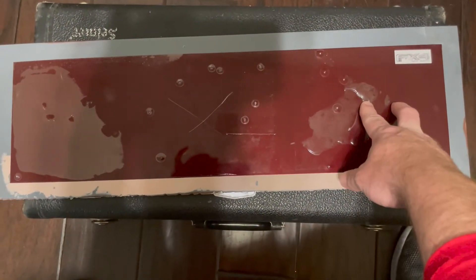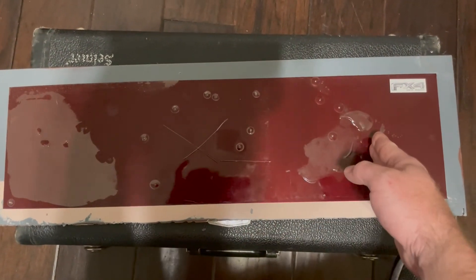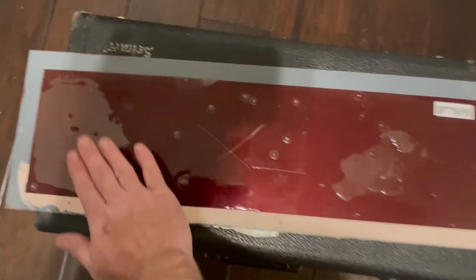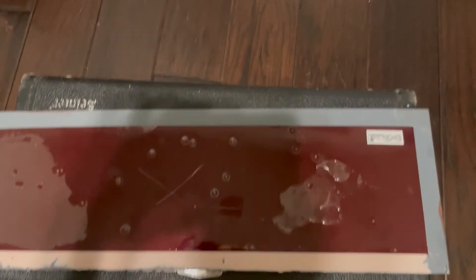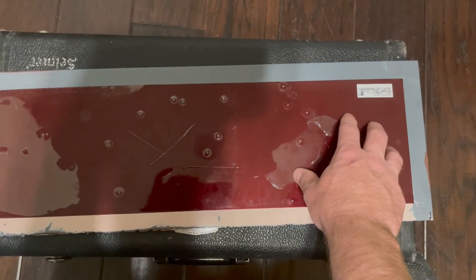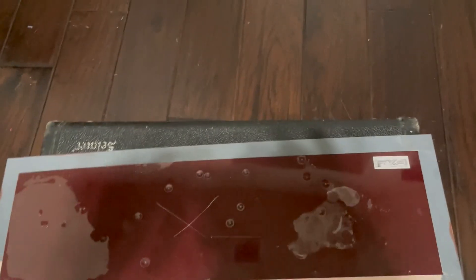Personally, I'm going to be spraying the Halo EFX on my personal vehicle for a couple of reasons. One, I feel like it protects a little better and is less likely to cause damage when you lift it. Two, it is significantly cheaper — on a DIY basis it's about half the price to buy the supplies for Halo EFX versus rolling out Xpel. Three, I'm not great at rolling out films — I always get air bubbles I can't get out — but I'm pretty decent with an HVLP. One thing to note: the Halo EFX sample was eight layers of Halo EFX with three layers of Sherwin-Williams clear on top. The Xpel was regular Xpel. The control was rattle can base with three coats of Sherwin-Williams clear.